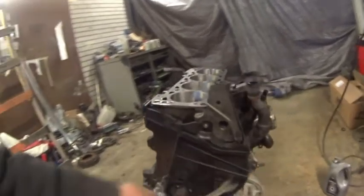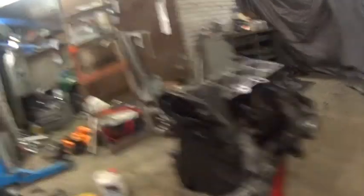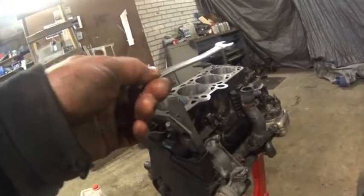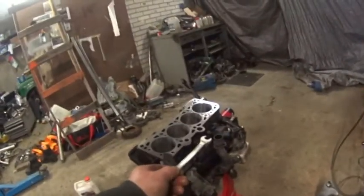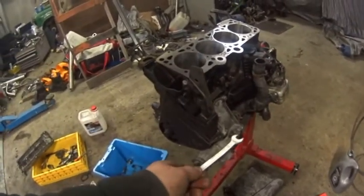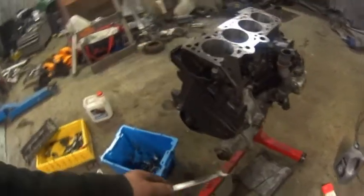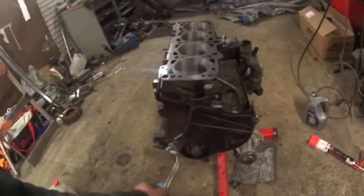So I can manage the new position of the alternator. Because in here was an air conditioning compressor and the alternator was on top of it, so now I put it lower. So I can make brackets and test fit the belt on it.